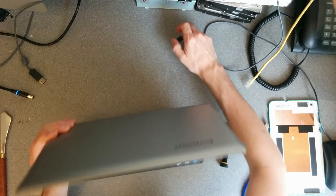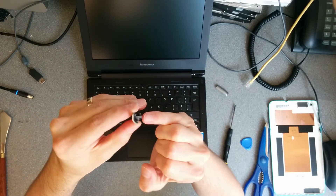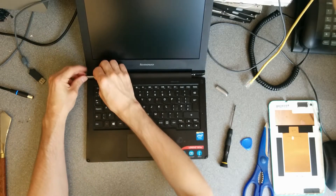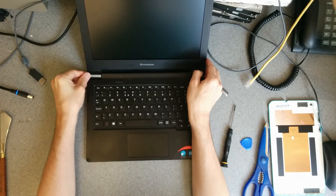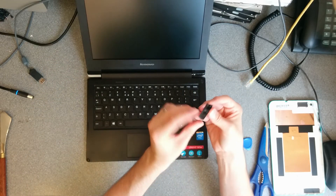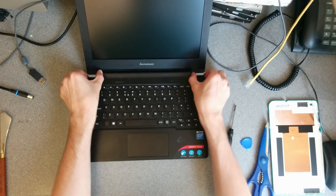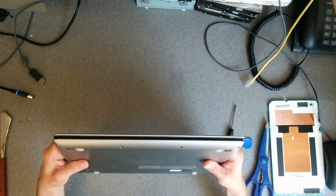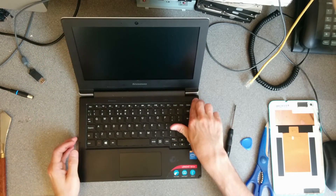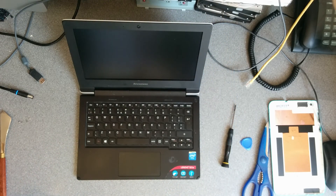Then find where you've placed the plastic covers. These little hook things are hooking downwards — so this one with the hook is on the left, and this one with the hook facing downwards goes on the right. It's a shame that I can't turn it on and show you just to be sure, but essentially that is how you replace a screen on a Lenovo S21e.